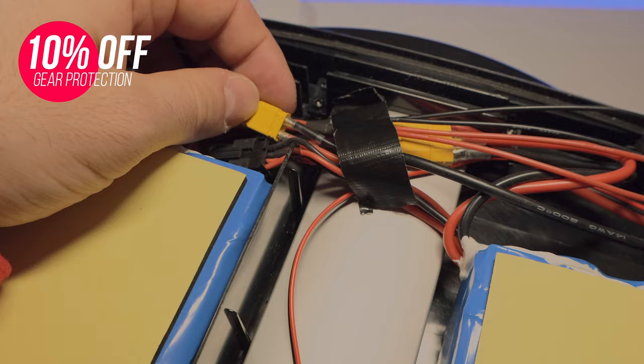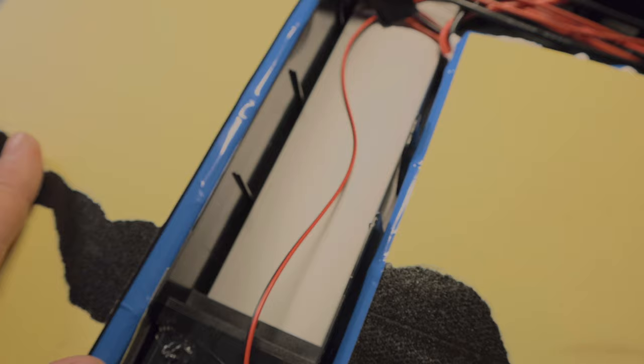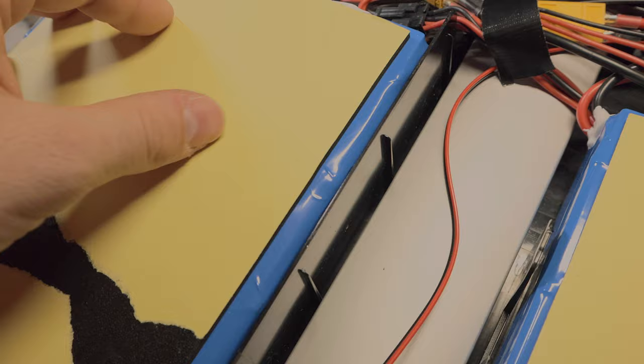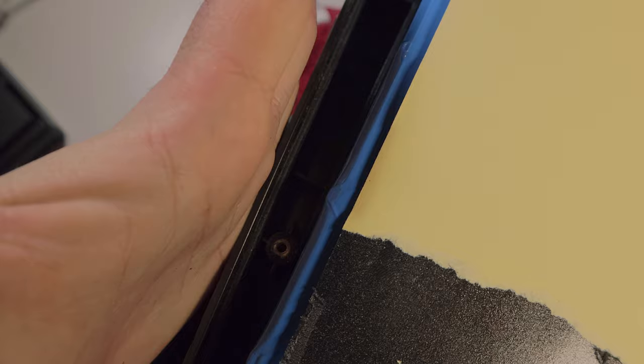The cables that we find here on the CX-60 are really, really thick. I'm not the best to talk about cable management, but this speaker cable I'm not really convinced with. Another thing we can see is they put what seems like rubber on top of the battery packs to make them even tighter. You can see rubber here on the bottom and rubber on the side. On the outside there is no rubber — so it doesn't make sense, because normally that's where you can have an impact on the wheel. They should have some rubber there.